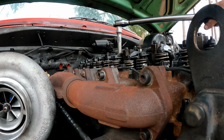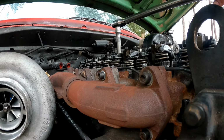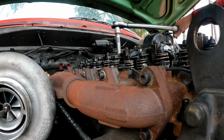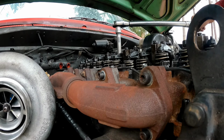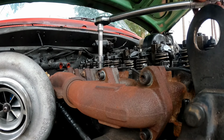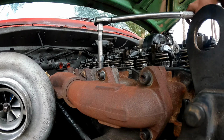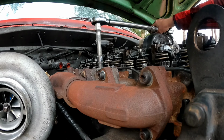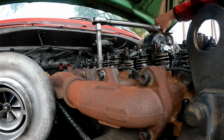We're on the last sequence at 125 foot-pounds. So let's do this last torque, and then the last one after that is we gotta do a hot torque, which means after we get this thing all the way back together, we gotta get it to running temps. Then once it's up to running temps, we turn it off and we go ahead and torque it again.